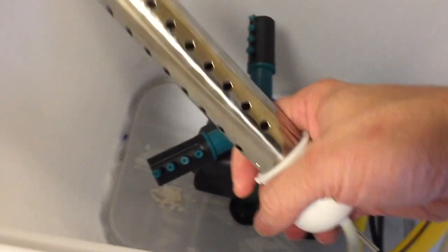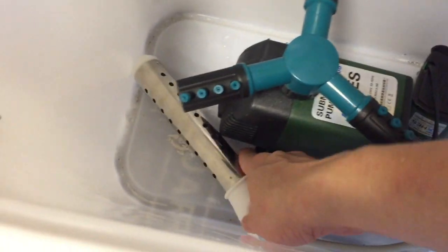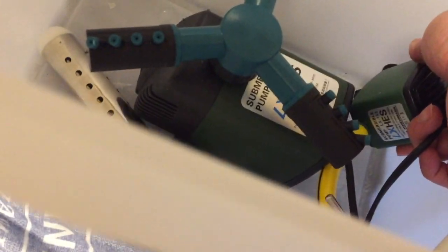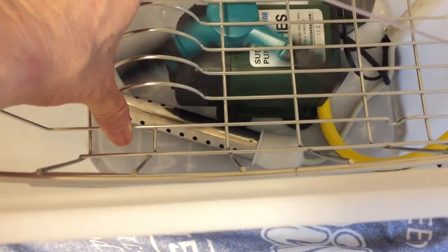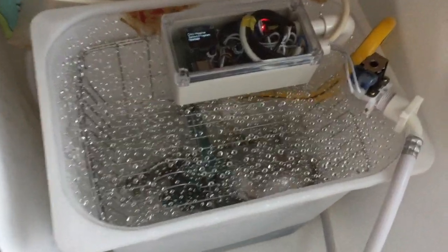The other component, which is optional, is this hot water tube heater. It is very hot and may melt the plastic if run dry without water, so be careful. You may want to install it with some heat-tolerating material at the base, just to lift it up a bit — don't let it touch the plastic directly. This is a drain pump, 15 watts. It needs to be powerful enough to drain the dirty water up the exhaust pipe. I used the acrylic cover so you can see what's going on inside. The washing basket for dishes needs to be small enough to sit in the tank without pushing too deep, otherwise it will stop the sprinkler.